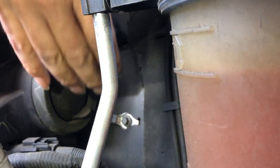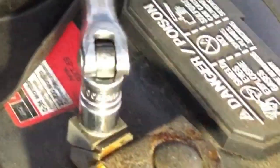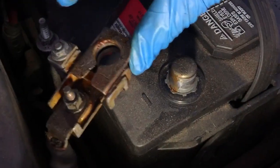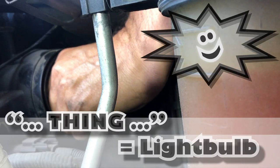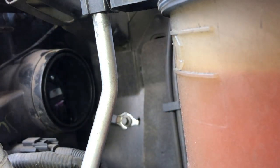So to do this quickly: pull the back dust cap off — and first disconnect the battery, which I already showed you. Disconnect the battery like you're supposed to. Once you've pulled the cap off, it's rubber so just grab it, bend it, and pull. There are actually tabs — you don't need to grab all of them, just get it off however you can.